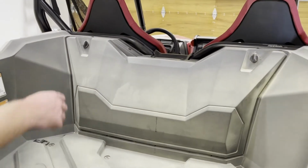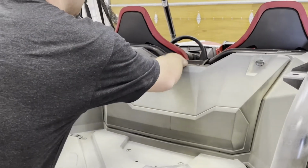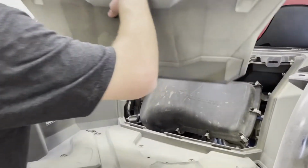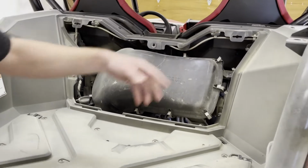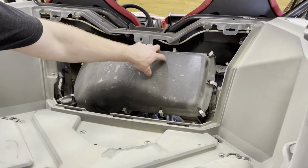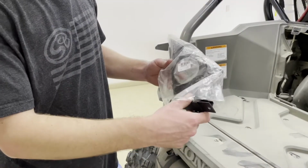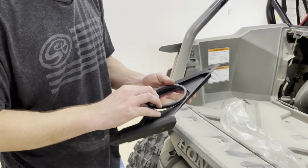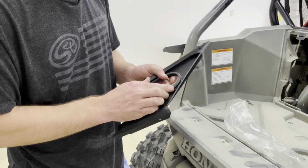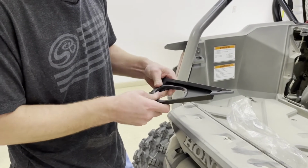We're going to move on and go ahead and remove the airbox cover, switching these 2 to the unlock side and then pulling backwards and upwards to expose the airbox. And if you had difficulty getting to the upper 2 clips on the snorkel tube, then you can also access them easily with this cover removed. I'm going to go ahead and remove the vent hole cover and the grommet included with the S&B separator, and get this grommet placed in so that we can get this installed into the car.